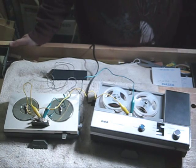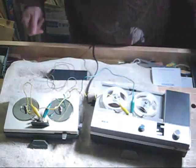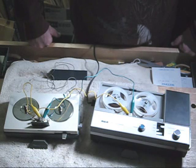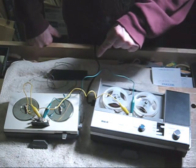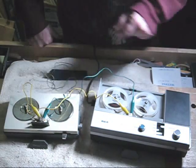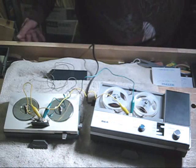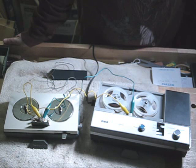To play Silly Silly Tape Recorder, you remove the two head covers so that you can get to the heads. You need two alligator clip-ended patch cords. I have a green one going from the right terminal to the right terminal, and a yellow one going from the left terminal to the left terminal. As long as those two connections follow the same orientation, you should be okay. Theoretically you should use a shielded cable, but I've found there's really no problem.